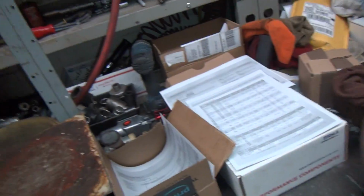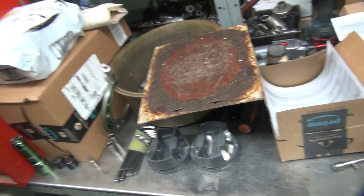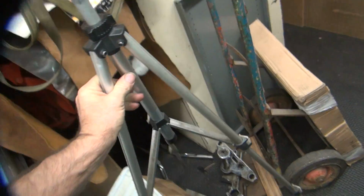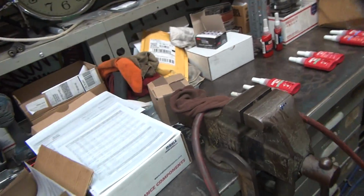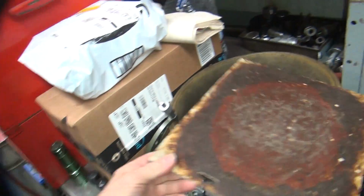Silicone, what it does is it just makes long stringy messes. It stretches out. Pretty much goes wherever you don't want it to be and it stays there. If it gets inside of an oil pump, it doesn't really chew up. It just plugs up the gears. It can shear keys off. Goes in oil galleries. It plugs up the oil flow. Nothing but problems with silicone. I hate it. So I don't use it. So there you go. Different stuff.